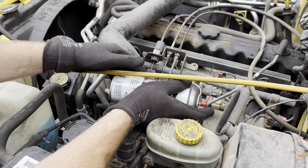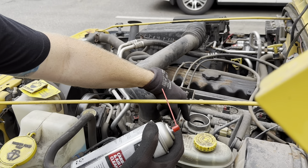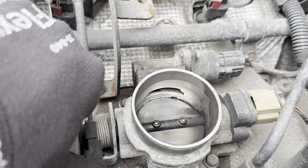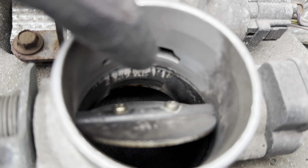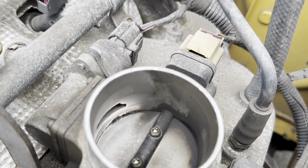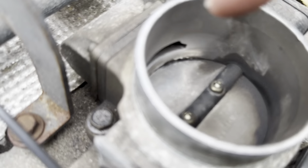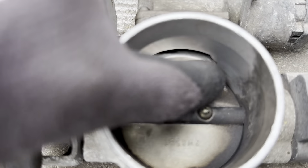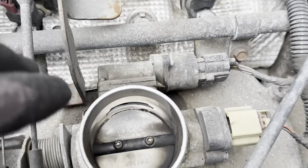It died again — I put too much in. As soon as we're done I'll show you the throttle body. All right, we got that all sprayed out. I just want to show you the throttle body — you can see just how dirty it is in here. I mean, that's filthy. So I'm going to go in and spray this all out, spray off the butterfly, spray off where it seals around the edges, get that all nice and clean and this baby should be ready to go back together.